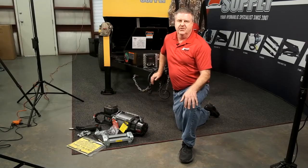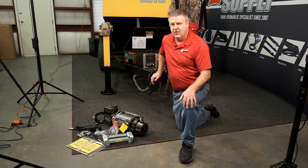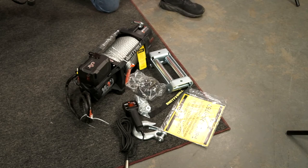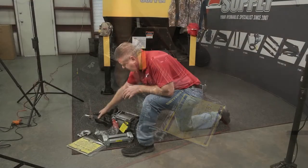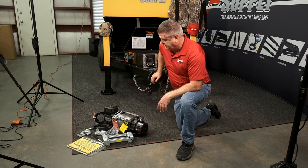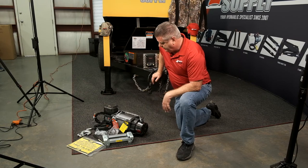One of the many popular things to put on trailers are winches. We are a Smittybilt winch dealer and offer a wide variety. The two most popular when it comes to trailers are the 10,000 lb, which is used on car haulers, and the 17,500 lb, which is used on roll-offs. They come standard with a wireless remote setup — you just disconnect here and there's your wireless remote. They are also waterproof standard. This is one of the many items that does create amp draw, so it goes back to a battery-related issue. You need to take good care of your batteries because these are amp draw hogs, but other than that they're a great product.